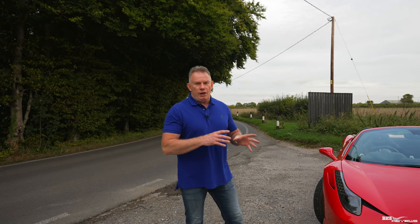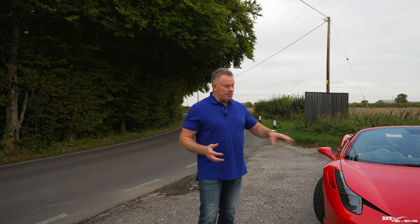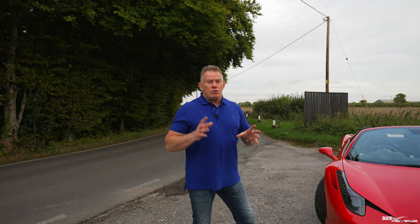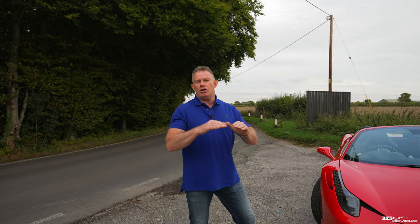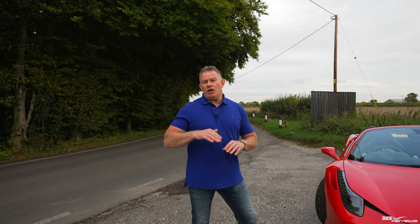Very, very important. Make sure also, even if your battery is in good condition, you should always keep your car on the battery conditioner anyway, especially these 458s. But make sure you've got your car on the battery conditioner for at least a day, preferably 2 days and nights, before you take part in any of these events. So it's fully topped up right to the top level, and it's as good as it can be, ready for your ModBall rally or for whatever rally you're performing, so that it can take not being on charge overnight for a few nights or however long your event is.